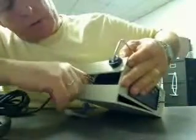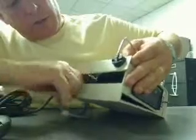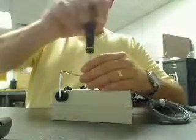Insert your two screws in the bottom. I always open it up just a little bit to make sure there are no crimped wires. Push any wires out of the way — you just don't want any crimped wires or a screw going through any wires, otherwise it won't function properly. Open the other side up, make sure there are no wires being crimped, then finish screwing the case together.